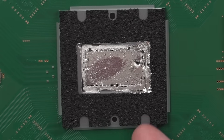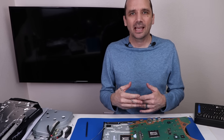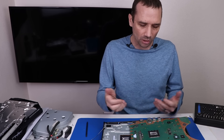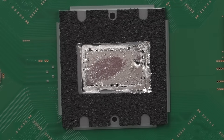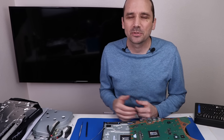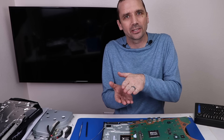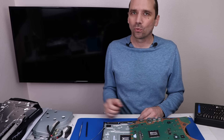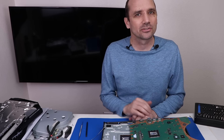The dry spot and oxidation on the APU could be either caused or exacerbated by a PS5 that has debris and hair clogging up the heat sinks. This causes the PS5 to run hotter, which could cause this to oxidize more than it normally would. So that's just another reason to keep your PS5 nice and clean. One of the things about keeping your PS5 up vertically is the liquid metal does seem to pool in the lower area of the APU. I personally recommend just keeping it horizontal, but I do know that a lot of people have had no problems at all keeping theirs up vertical.